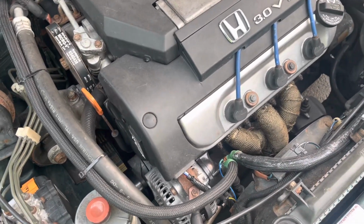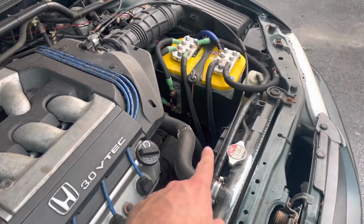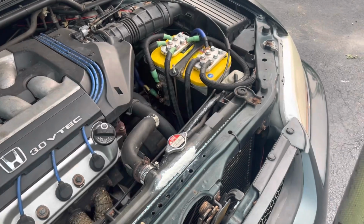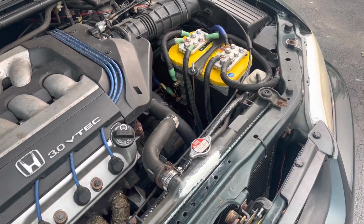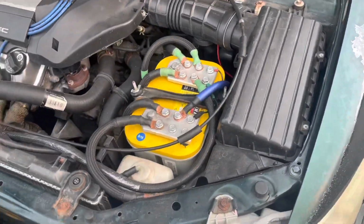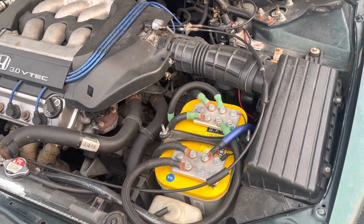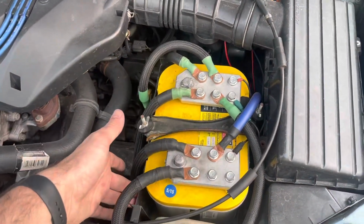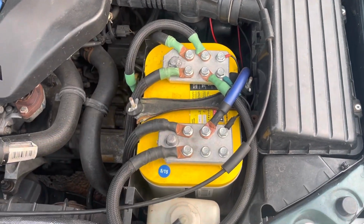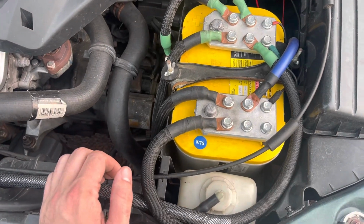Oil is draining. What else? Oil's draining. Battery's got to come out. I'm just gonna put that wire up to there because we don't need a fuse holder in the front because that's not a battery anymore. Only fuses at the battery. Add the ground to here. We'll do that once the battery delete is in here. I'm gonna take the plastic thing and the battery hold down out and just bolt the thing to the battery tray, or attempt to. That would be the goal.